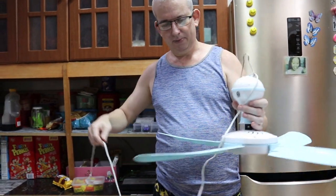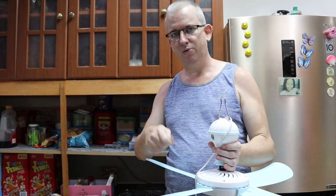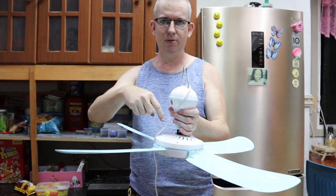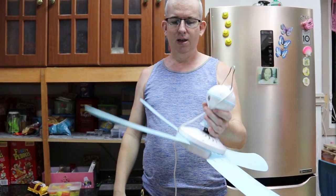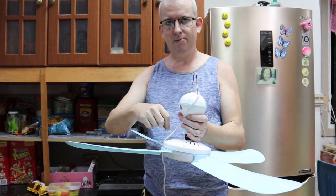So now, because I didn't have these before, we had it wired with a little piece of wire. It didn't work, but it removes the safety mechanism part. It won't drop if something happens to the fan. The wire is holding it. The E-clip won't detach. It won't drop. It'll still spin, catch on fire, all that. So by having it wired up, the safety mechanism won't work.